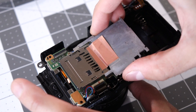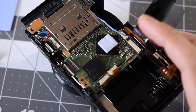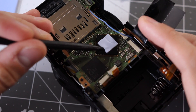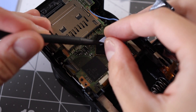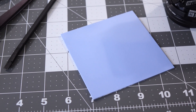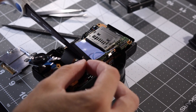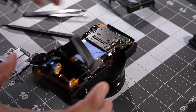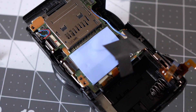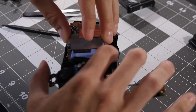With the shield removed, the heatsink is exposed, sitting between the SD card slot and battery compartment. I took out the single screw at the bottom and lifted the heatsink away. I was a bit surprised by what I saw — namely that the main processor already had a thermal pad on it. Granted, the Wi-Fi antenna was stuck in the middle, but it was a step in the right direction. But the other chip below it didn't have anything on it, and I suspected it might be the cause of the overheating. I had bought some 1mm thick thermal pad material and cut a piece big enough to cover both chips and replaced the pad that was already there. I trimmed back the black plastic shield, then put the heatsink back on, and found that the thermal pad was too thin to make contact. So I cut another piece and laid it on top, but then it became too thick. I resigned myself to the fact that I wouldn't be finishing the mod that day and needed to do some more research.